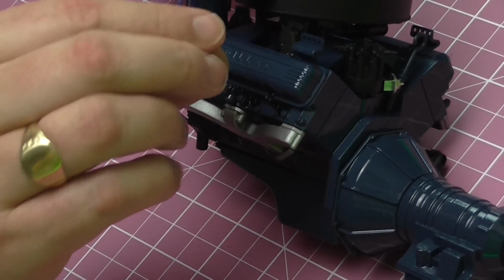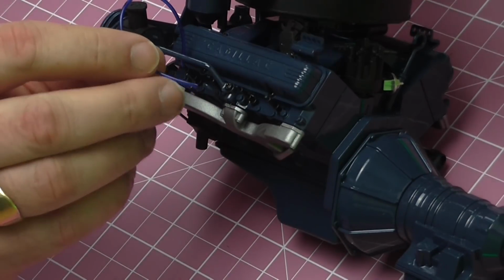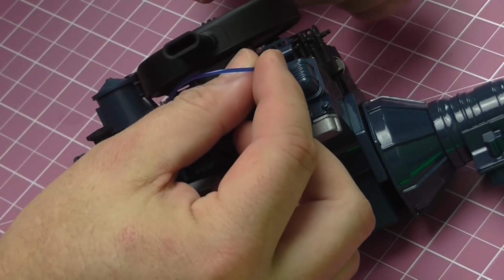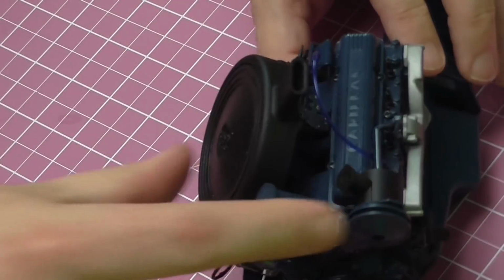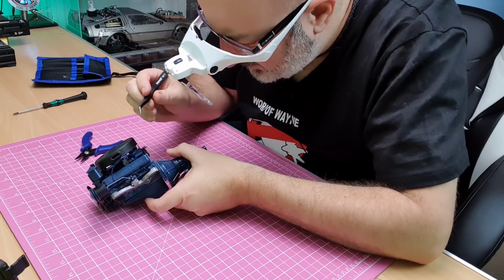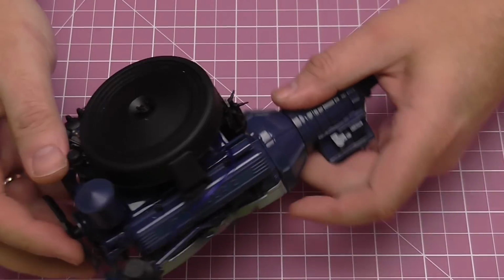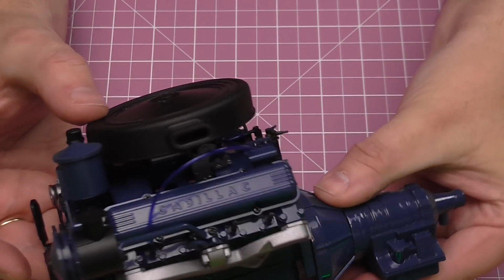And then we're going to have it trailing over here, going through the first hole of the HT lead little tidy that we've got there with the 4 holes. Going to go through the first hole, and it's going to go onto the nearest section of the distributor cap. So I'm going to get this in. Got my glasses on. I'm going to push this into place. And there we go. That was the first one into place, just like that.